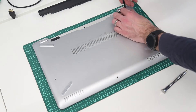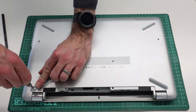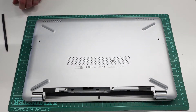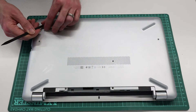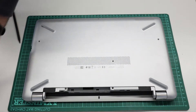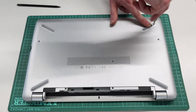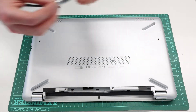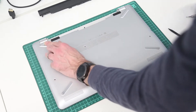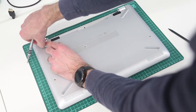Next, having removed those, we need to take our pry tool and just lift the corner feet, as each of these has a single screw under it towards the corner of the laptop. With these feet we can just lift the corner and they should stick back down — it shouldn't be necessary to replace any of the adhesive tape. Just try to let them sit back down without getting too much dust or grime into them.